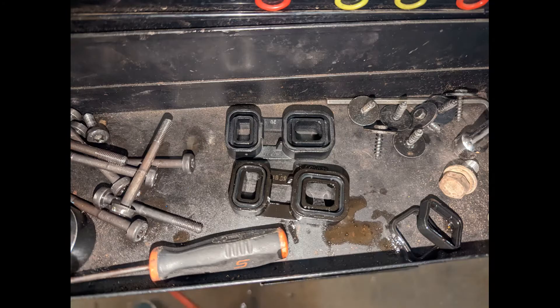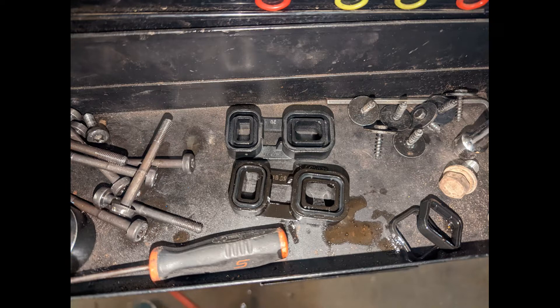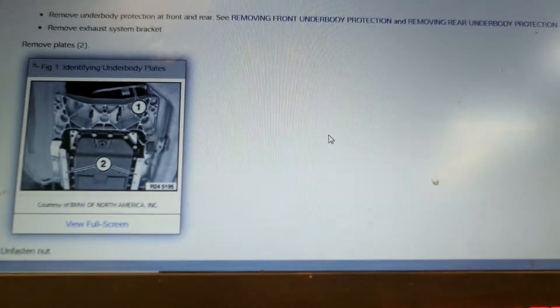You need to look at your old plastic to make sure there are no cracks around the edging, because they can crack as well. If you find that your plastic is cracked, then you need to purchase the right seal. If it looks fine, just swap the seals themselves over into the new plastic, then insert it into the transmission — it should sit up there just like this.